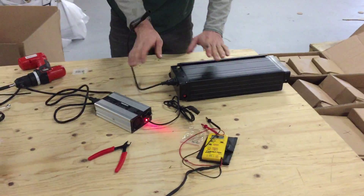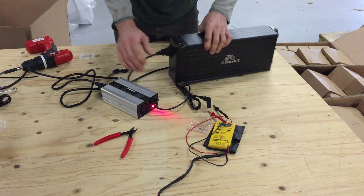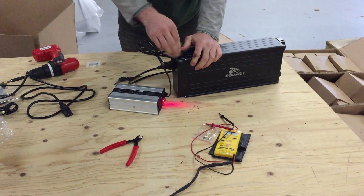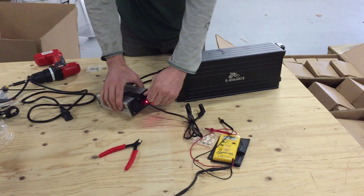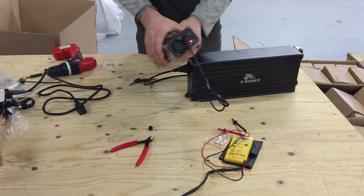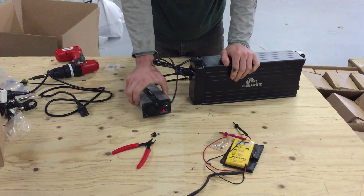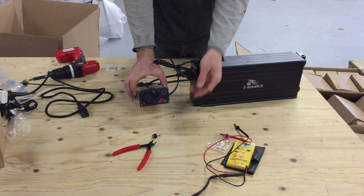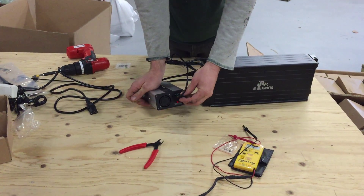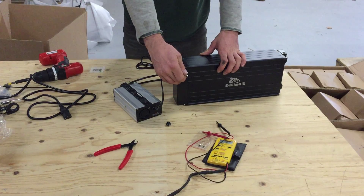We know both the battery and charger are doing well. If we had a problem on either end, we would have replaced a fuse. There's one other thing to check. Let's say the charger was not charging — when we connect the charger to the battery, we did not get that light. So the battery's not charging but seems okay otherwise. If I take the cable fuse out and let the light go out, then plug into the charger, notice the light doesn't come on. In our case it's because the fuse isn't there, but let's say the fuse was installed and the light's still not coming on. There are two possibilities: the fuse in the cable could be bad, or the fuse in the battery for the charging port could be bad. There are two fuses — one for the bike inside one end cap, and one for the charger inside the other end cap.